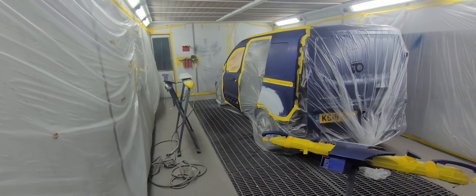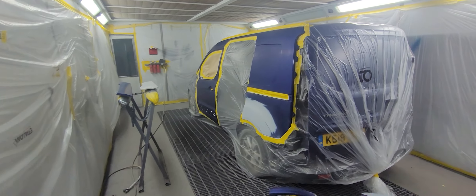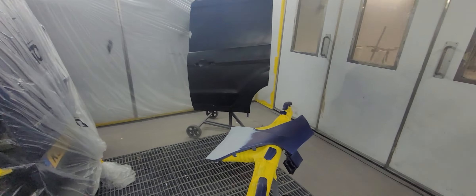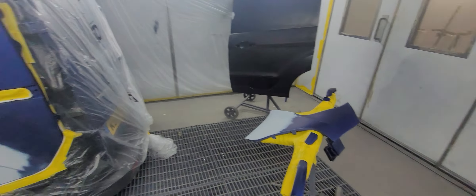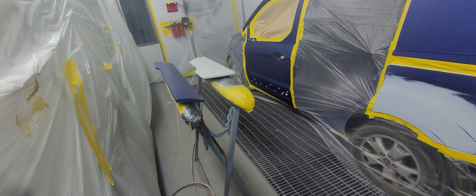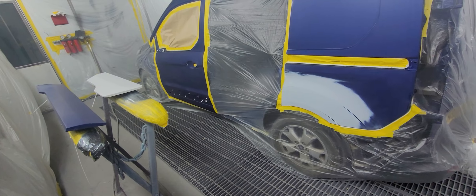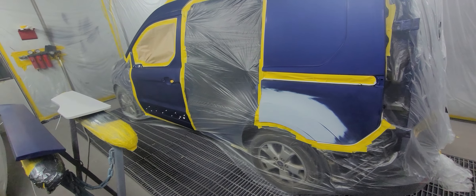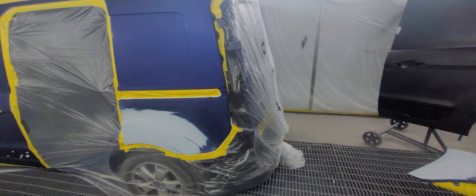...door pair on the rear quarter, bumper corner, handles, two side trims, blend on the front door. We're gonna put down a black wet-and-wet on this because the coverage is shit. So black wet-and-wet on the edge of that, black wet-and-wet on the edge of there, black wet-and-wet on there, maybe down the edge of that door as well.